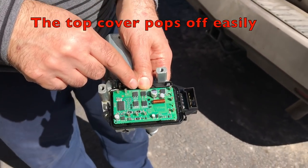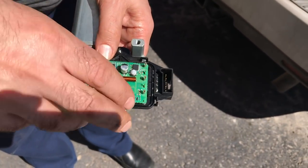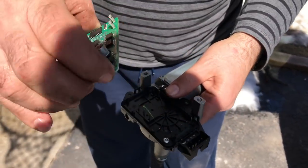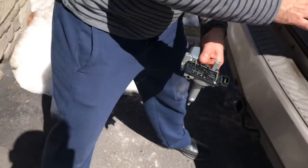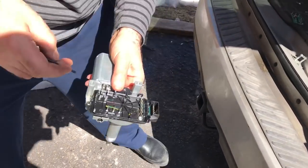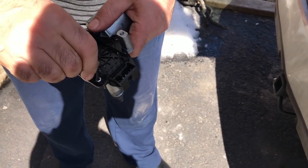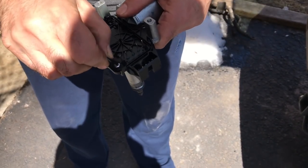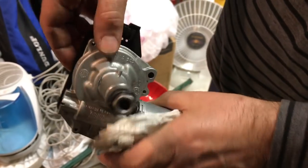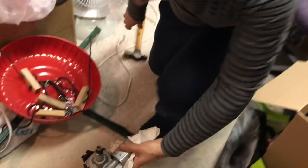You're going to notice there's a couple of little plastic tabs — this seems to be the main one. If you pull this one back and you gently pull straight up, you're going to see that the circuit board comes right off. So be gentle with it, because if you ruin this, you're probably looking at buying a new motor. Now we're able to get the last screw out, and then this will hopefully give us access to the shaft. What I've done now is bent this back just a little bit, because what I need to do is put a nut on here and bang the shaft out of the housing.